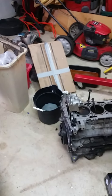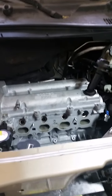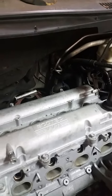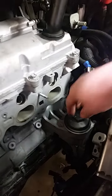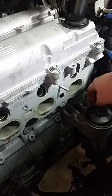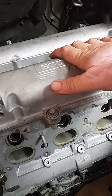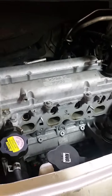The original motor went 200,000 miles with oil changes when the computer said it was time, around 15 to 20 percent. I bought a rebuilt engine — they've been pretty good to deal with — but it came with no oil pressure, which was scary because I had no warning light, just a horrible racket. After running it 15 to 20 minutes, I pulled the oil filter cap and it was bone dry — no oil circulating whatsoever. I also pulled the valve cover and it was completely dry.